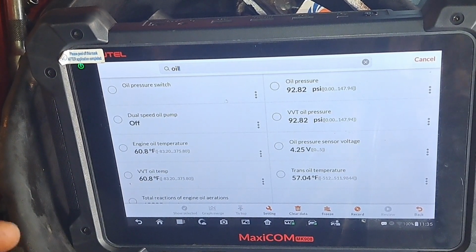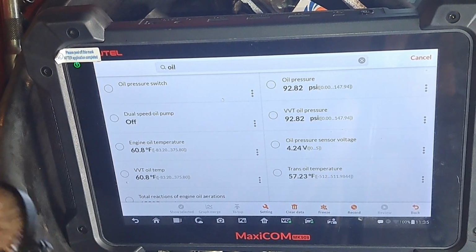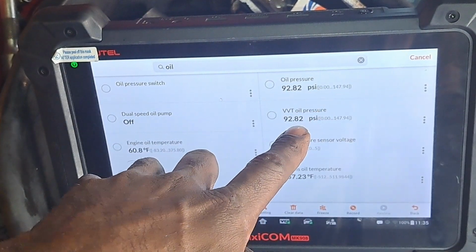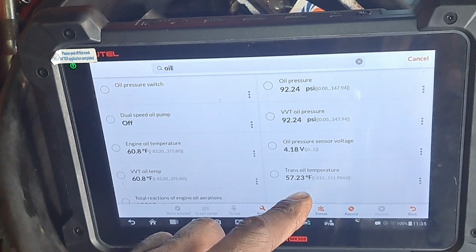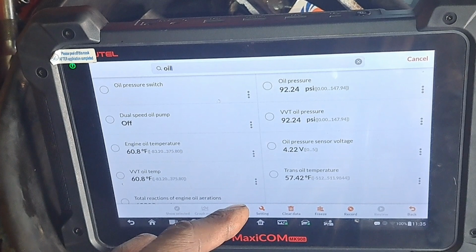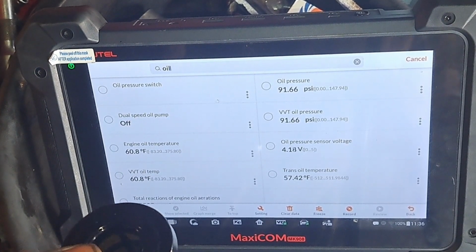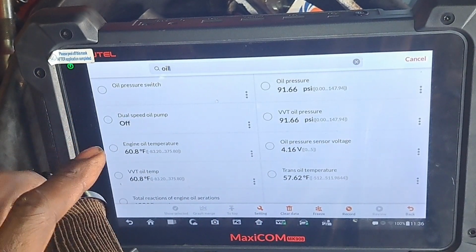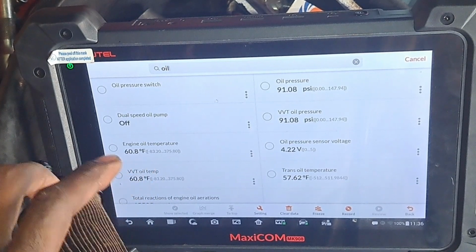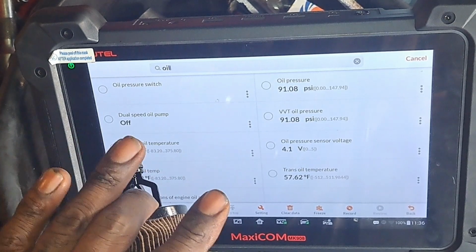Let me explain. The vehicle can monitor its oil pressure based off of what it sees through the oil pressure sensor here. Now, if it's not producing oil pressure, yes, in a way, thinner oil would have helped, because what we saw was a stopped up pickup tube. That 5W20 will be capable of bypassing that a lot easier than the 5W30 I got in there. Okay, logically. However, no oil should make any type of difference as far as normal running conditions, for normal driving conditions.